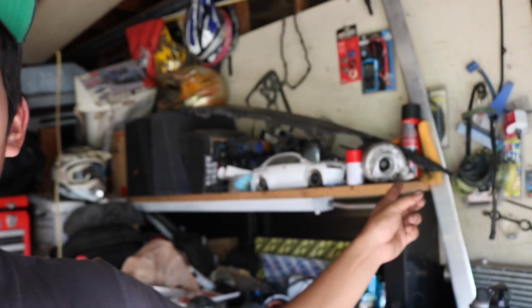So this truck is going to get a fuel pump, eventually it's going to get injectors, it's going to get more boost. I have the piggyback SAFC that I'm going to be running, and just a bunch of stuff. Right now I'm just doing it as budget as possible, and I want to see how much this turbo can hold, because realistically I don't think this turbo can hold more than 10 pounds reliably. I think the turbo is going to go anytime soon. So right now I'm just making it boost, and whatever breaks or goes bad, I'm going to swap it with good parts that I have, as you can see right there. A Garrett name brand turbo, and I'm running an eBay one on the truck. So I really just want to see what this turbo can do and how cheap I can get around doing this.